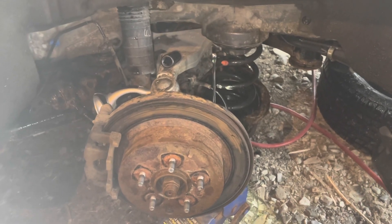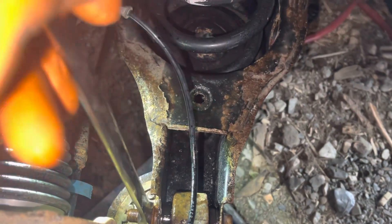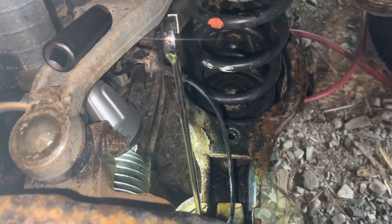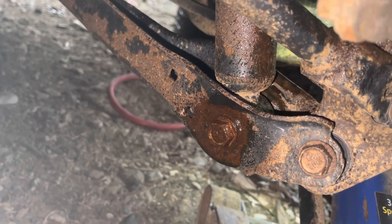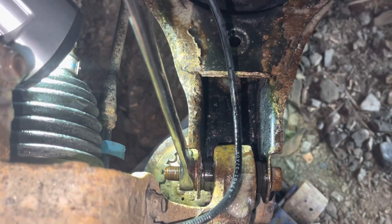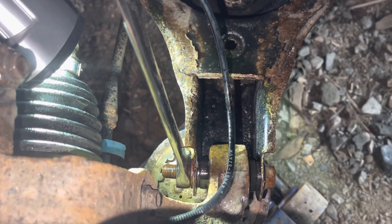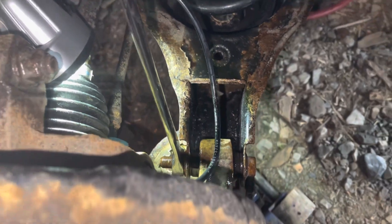We're here on the driver's side. We're going to do both sides, hopefully tonight. I've got a wrench right here — it's 18 mil if it matters to you. As a side note, the most common metric size to be left out of any set is 18 mil, so you might want to check your tools before you decide to break into this. We're going to get that bolt off. I've got a jack under it to support the weight and we're going to let it down. I'm also doing the shock while I'm in here, so there's another 18 mil bolt right there. This one has a welded nut on it, but this nut is not welded, so we've got to hold it. I've got some air tools — they're cheap, mostly because I do this to save money. You don't need air tools, I did it for a lot of years without them, but I'm going to try with those because it often makes it easier.